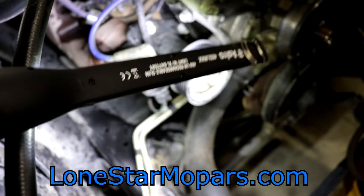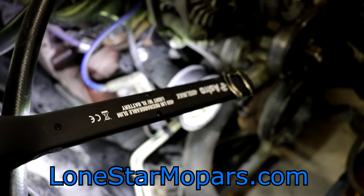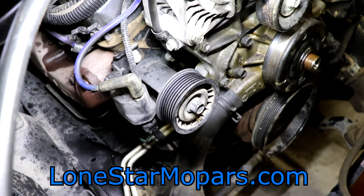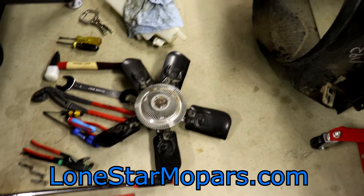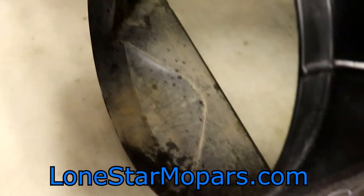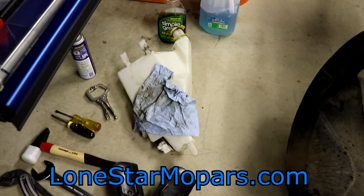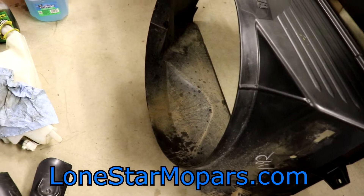We'll probably pull the lower hose tonight — it's just a constant tension clamp there, and there's another one back towards the front. Keep in mind we've drained the radiator but there may still be residual fluid. When you pull the lower radiator hose it might be advantageous to start down here, keep a bend in it, have your bucket there, and dump it in. The fan shroud and clutch fan — not too dirty, just some WD-40 splashes. On the inside it's an area you don't have good access to ever.